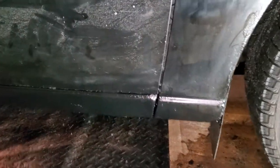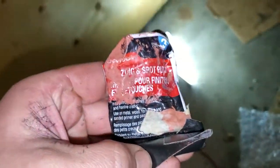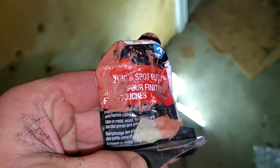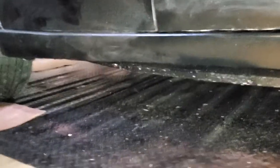If you have a car with rusty rocker panels, what you can do is use a steel brush to clean up what you can. Sometimes it won't just be surface rust — it'll be holes right through. For that, I would recommend using something like spot putty, but that's just for small fills. For larger holes, you can get a short strand fiberglass filler.